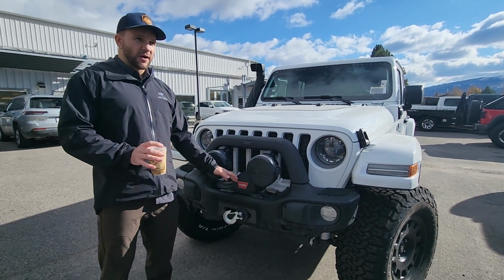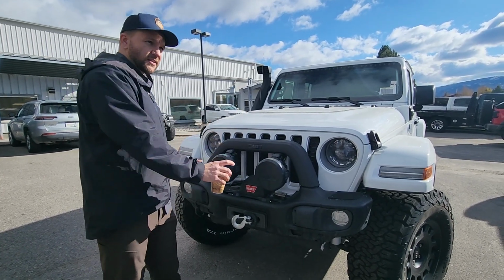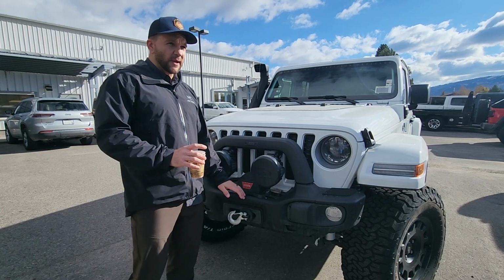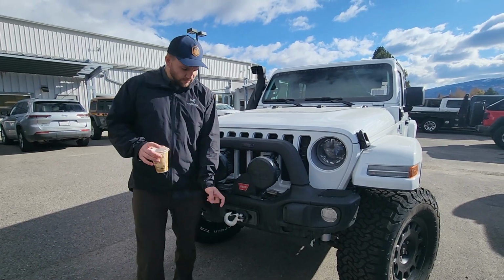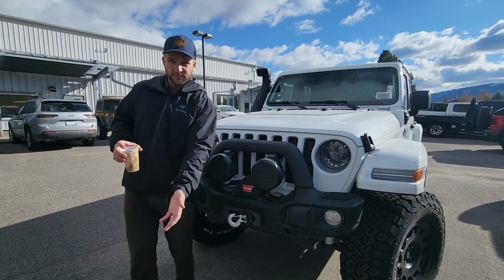Synthetic doesn't have any of those drawbacks. It's not as heavy, so it's not drawing as much power. It's not as much weight sitting on the front. But the safety factor is the big one, the one you want to focus on. So I could literally hook this guy up and pull him out from here and stand here. If that cable snaps, it'll just drop to the ground.